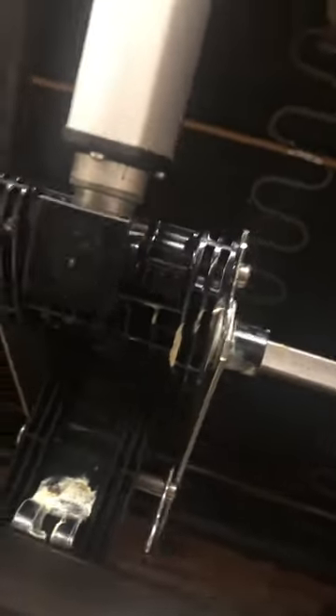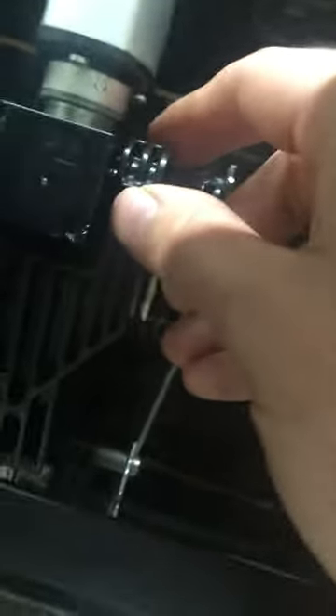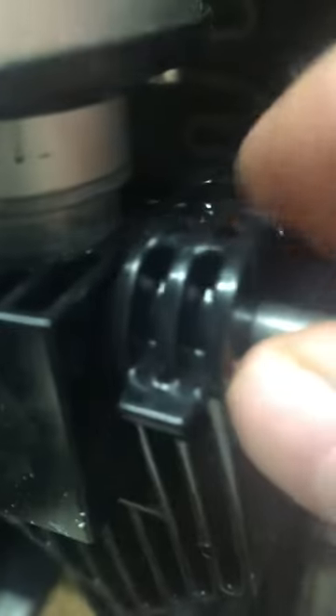To replace your rat tail piece, make sure the footrest is closed and have your motor set pretty much all the way back. Take your piece and insert it into that slot, then this end piece will sit over that motor cap. Take your pin and slide it into that end and through that hole on the motor.